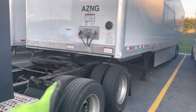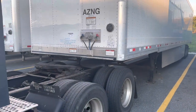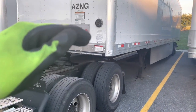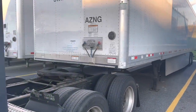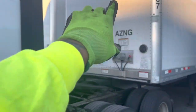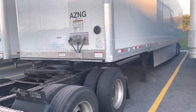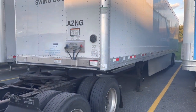I stopped here in this position because it's important to note that when you're backing into a trailer, a lot of times people don't even look at how high or how low the trailer is and they'll just back up into it directly. That can cause you to damage the flaps against the trailer, because it's not going to feel the pressure of hitting the fifth wheel and slowing down — it's just going to ram into the trailer. So it's very important that you check that when coupling and uncoupling.